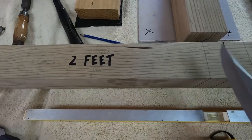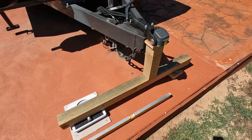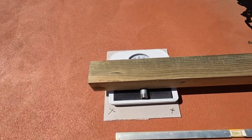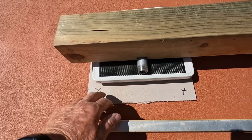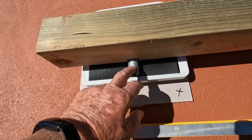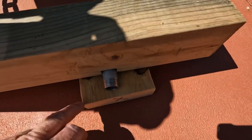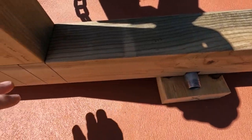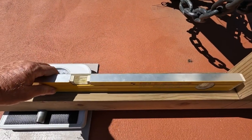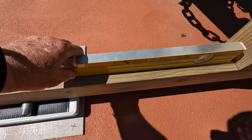Let's take it all outside and have a look how it works on the caravan. Here it is all set up, ready for the caravan to be checked. I've just got a little bit of a plate there - a base plate for the scales. That there is just a bit of mesh to protect the scale top from this pipe from sinking in, it also helps with the height. This side, I just have a bit of a block there again, just to help with the height, to get this block of wood level. This wood's got to be level - we'll have a quick look at that. And of course, there's the bubble - it's spot on, virtually perfect. It's got to be level, otherwise it won't work properly.